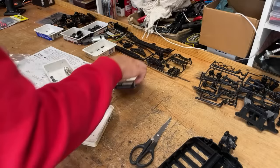These Air Racing ones, they look really well made shocks actually. They look nice. Isn't that nice? So you put the oil in, and then you give it a couple of pumps. What that does is it gets the air bubbles out from under the piston. Then I put them up here just to chill for a minute, just so that the air can bleed out. If you're really fussy, you could wait an hour for all the air bubbles to fully come out, but I don't care, I'm not in it, am I? Not in the damn thing.